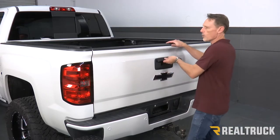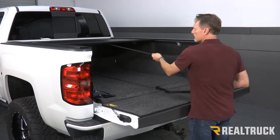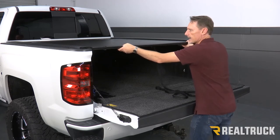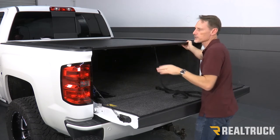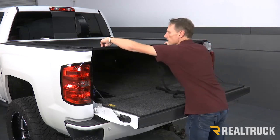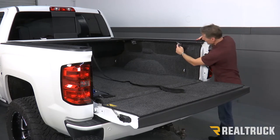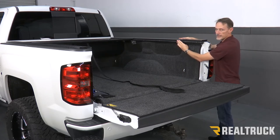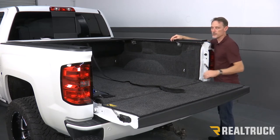Next, go ahead and open the tailgate. Grab the strap and pull the cover all the way to the tailgate. Now, shift the cover side to side and see exactly how much play we have from one side to the other. If we are within one fourth of an inch of play side to side, we do not have to install any shims. If there's more than one quarter inch play, we want to go to the rear clamp on each side, take the clamp off, and install 1/8th inch shims between the rail of the cover and the bed cap — however much shim you need. You need to do the exact same amount of shim on one side as you do on the opposite side.